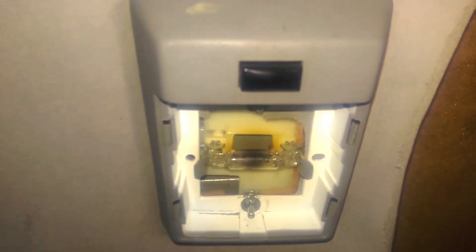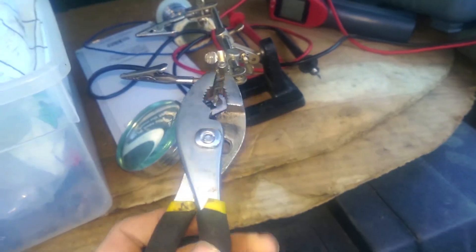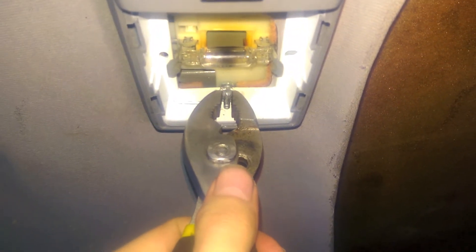I got the cover back on, everything's all cleaned up, looking pretty. You can't even see the wire — it's way back there and hidden pretty well. You can see it a little but I think that's a pretty good job, I'm happy with that. This panel's back on. To get the little pins back in I used some pliers held slightly open — you push it in, it takes some resistance, but once it goes it'll slide up in there and lock in place. With the bulb back in, light comes on.